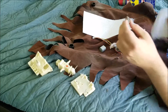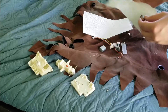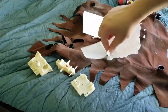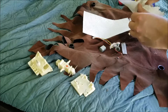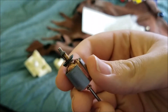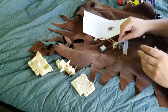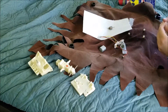Take your paper towel — if you look onto that motor shaft, you're going to see all that black stuff. That's what we're going to clean. You're going to want to pinch your paper towel like this on the commutator end, not on the shaft end, and turn the motor back and forth very slowly. You can see how a bunch of junk is already starting to come off — this will clean the brushes and make it have better performance. The same thing applies to the brushes — you want to make sure the brushes are clean, because if the brushes are not clean, the motor will not receive power and it will not work. This is a brushed DC motor.